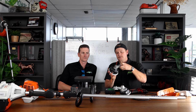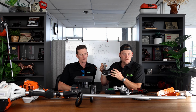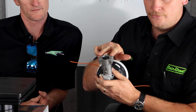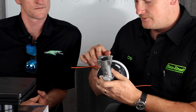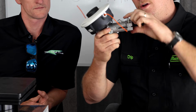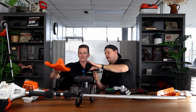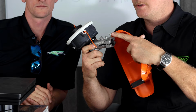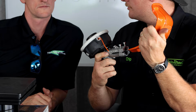Versus the 111RX has a plastic portion here. I guess a portion of what was aluminum is now plastic. They shaved that aluminum off. It has 2 mounting screws on your clamp like the old style versus the one. That's interesting. It uses a hook mechanism to hook your guard on and no big metal washer plate. And the 2 screws that actually mount your shaft or your head to your shaft are the same screws that mount your guard, so you don't have additional 4 screws.